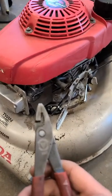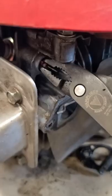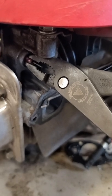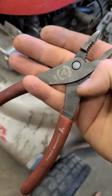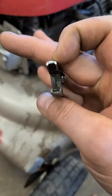Hey guys, welcome back. Today I want to show you the best pliers to use to remove the choke cartridge on some Honda lawnmowers. Here's the small cartridge — sometimes this little cartridge will be stuck in there and you do need pliers. The reason why these vampire pliers work the best is because of the way they're shaped at the tip.